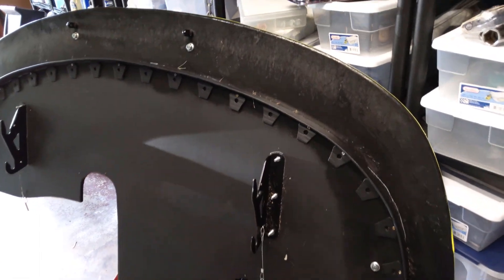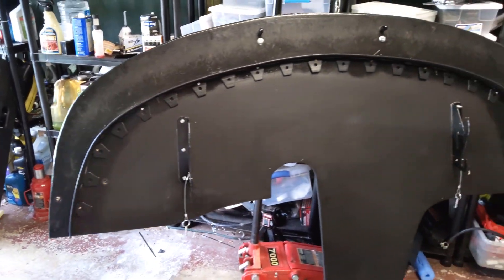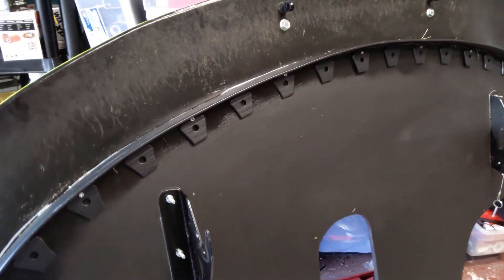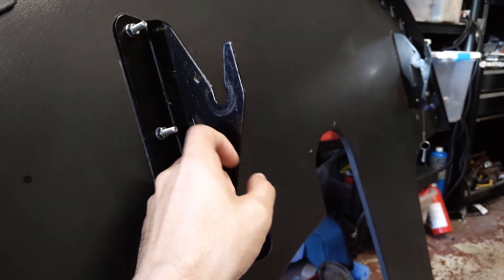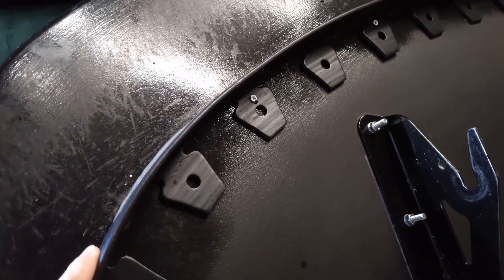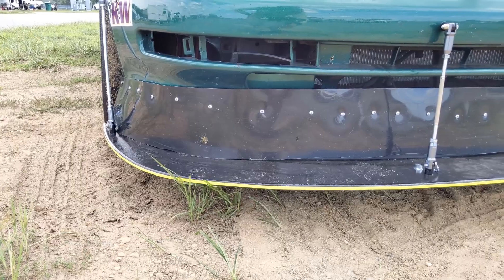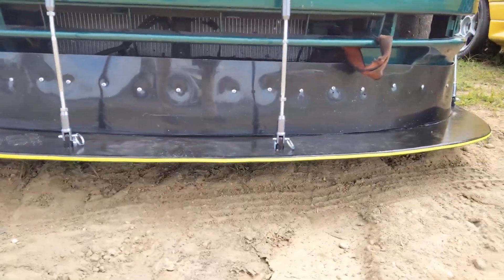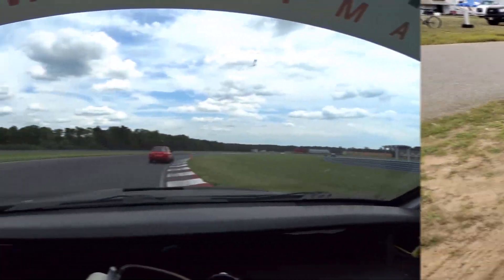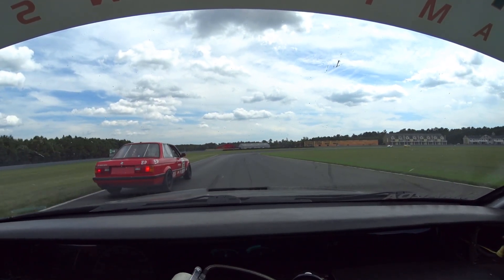This enormous splitter is made of one half inch thick plywood board. This one was fabricated for me by Brian Bennett of Bennett Engineered Motorsports in Florida, but with a bit of patience and some woodworking tools, you could make this yourself at home. These quick release splitter brackets were about $75. This little lip here is a support for the air dam, and it's actually a piece of landscaping edging held in with bolts. The air dam itself was cut from a $20 roll of plastic sheeting. You could build this air dam and splitter for about 150 US dollars in materials. It's very strong, and like the wing, it produces a fair amount of downforce.